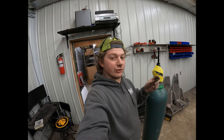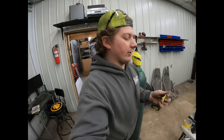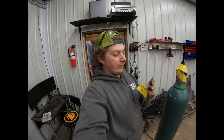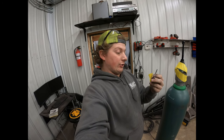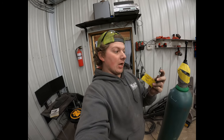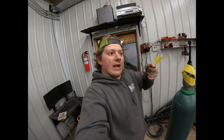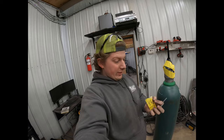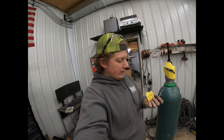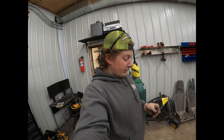I actually had to modify the rod. I had to straighten the bend back out. So on this one, on that arm, on the handle, this piece here just goes up into it, and I had to heat it up, straighten this all out, and then move the bend up because the handle had too much play in it. It would still pop the door, but it was right at the very end of the throw of the handle. So I straightened it back out and re-bent this 90 into it, or this double 90 into it. So we'll flip the door back over and see if I have to do that to this one too. Give you guys a good view here.